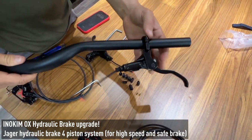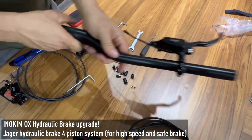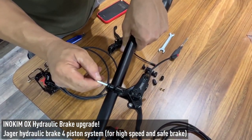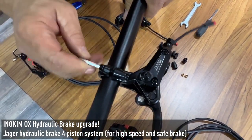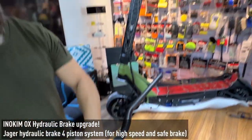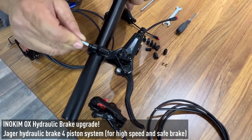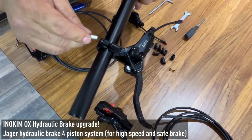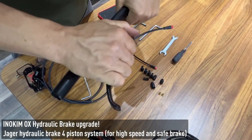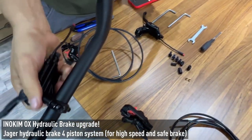Open the M4 a little bit so it will go smoothly onto the pipe of the scooter stem. Now it becomes wider. Place it right inside in this position, as you see here. Tighten it back in place after giving it the right position. Close the Allen key and change the direction — left, up, down — according to how you want it, according to your stem.